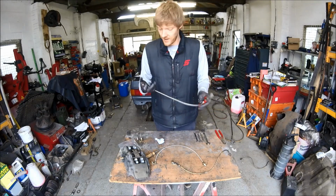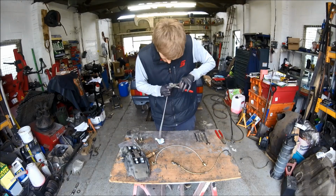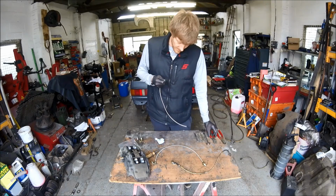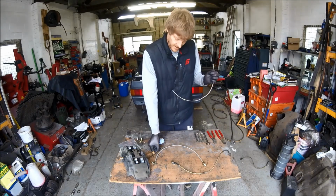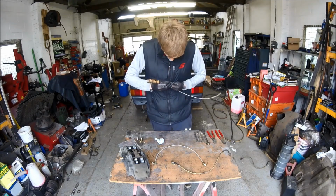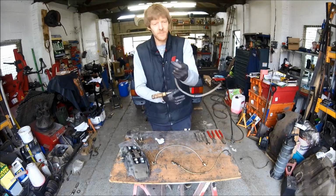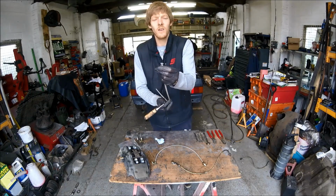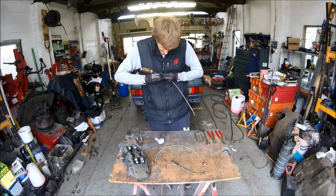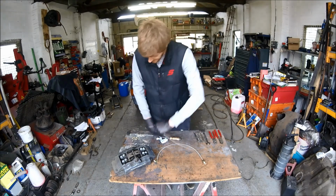And then you'll want to get a decent pair of pliers so that you can reform the plastic pipe so that it goes round again rather than being oval. Once you've done that, the next step is to get a small screwdriver, slowly tease the braiding back away from the poly pipe on the inside, so you're left with a very unpretty, undressed pipe. Doesn't need to be too far down.